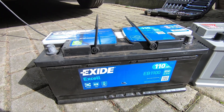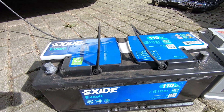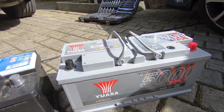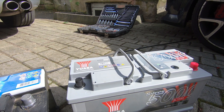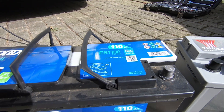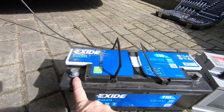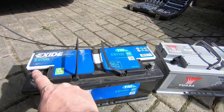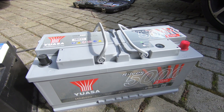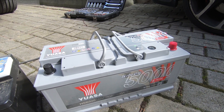Here are the two batteries side by side. This is the one that came out of the car — the car's a 2007, and I'm pretty sure this isn't the original one. This is the replacement I'm putting in. They're slightly different specifications: the new one is 110 amp with 900 amp cranking power, and the old one is 110 amp with 850 amp cranking power. As long as they're physically the right size to fit in and your terminals are the right way around, it doesn't really matter too much what power the battery is, as long as it's at least 110 amp for the S8 because the S8 does have a lot of systems which draw power.